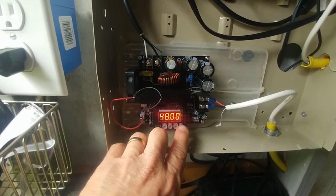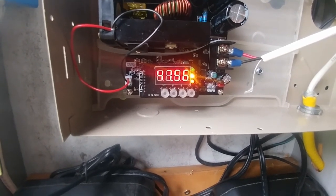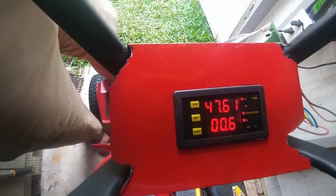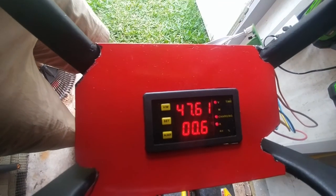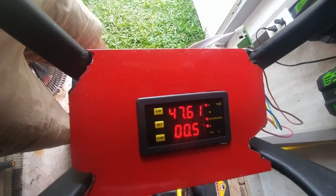I'm okay with that because nothing here gets hot and nothing is pushed very hard. When I push this button it will begin arranging the voltage needed to push one amp into that battery. Looking at the battery, it seemed to lose quite a bit while I was mowing; however, after shutting it off, the voltage came back up to about 47.6 volts, so it didn't pull out as much as the gauge read while running — I'm not sure why that is. I think if I mow my whole lawn it'll take maybe 15 hours to charge, but I'll have 7 days during which I could charge it. Anyway, that's it — thank you for watching.